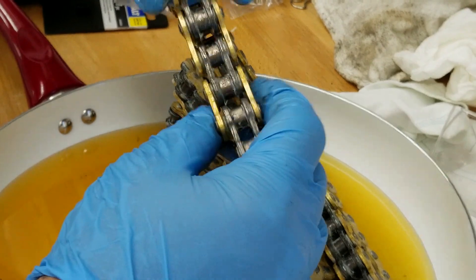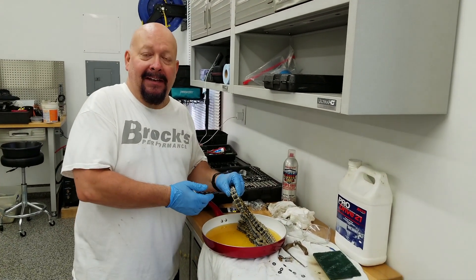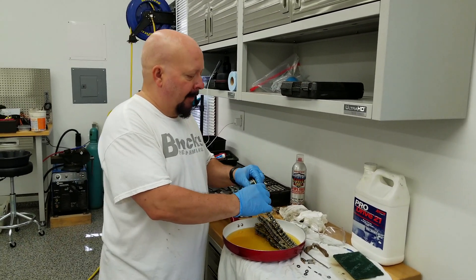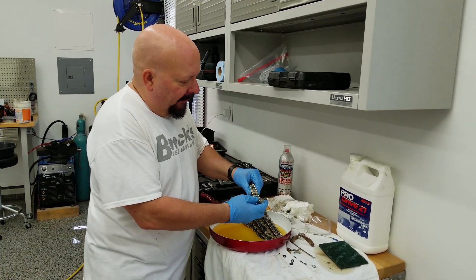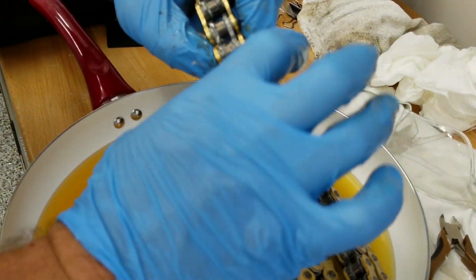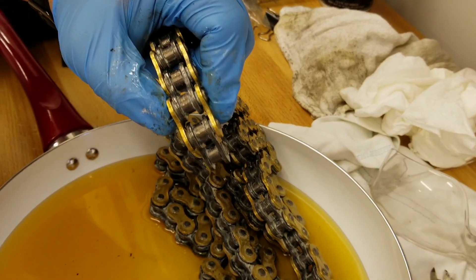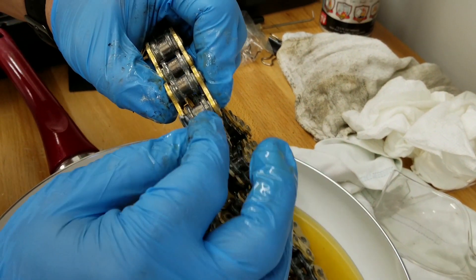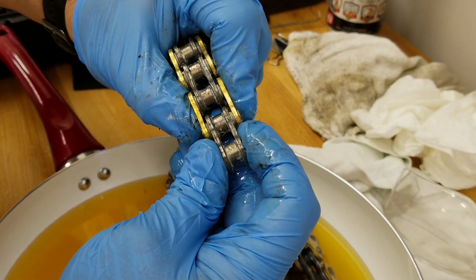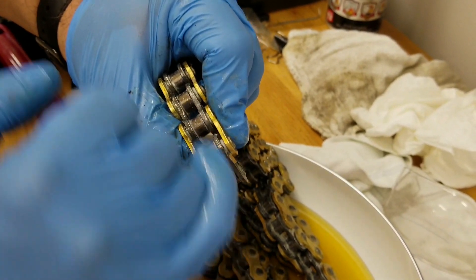It's very painstaking. So, Brock, why don't you just use a non-O-ring chain? Great point, and it's a great alternative, especially if you don't want to do the work. But if you come over here — on a non-O-ring chain, when they press them together, you get friction between the plates and rollers. If you've got an O-ring chain and you remove the O-ring, look at that plate — very little friction here.